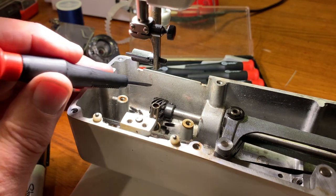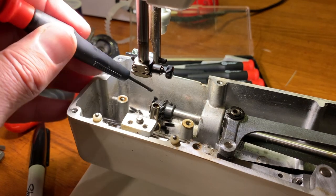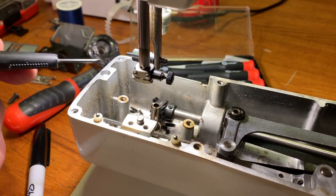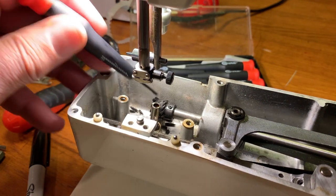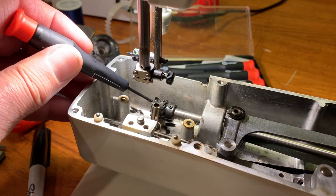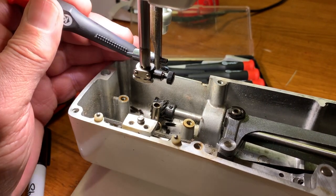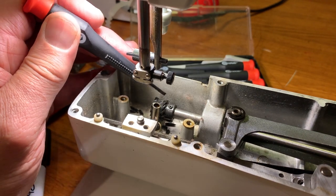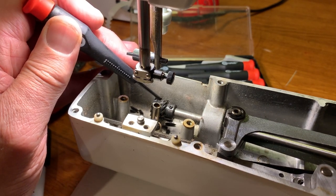Now here's the thing. The timing of this machine is of course out because the hook is disengaged entirely from this gear since it's all stripped out. However, since that belt is totally linked up with this bottom shaft drive and the top, when I put this machine back together again, I'm going to show you how to seat the hook and make sure you got it right. What I need to do is put the new gear on in exactly the same orientation as this old one.